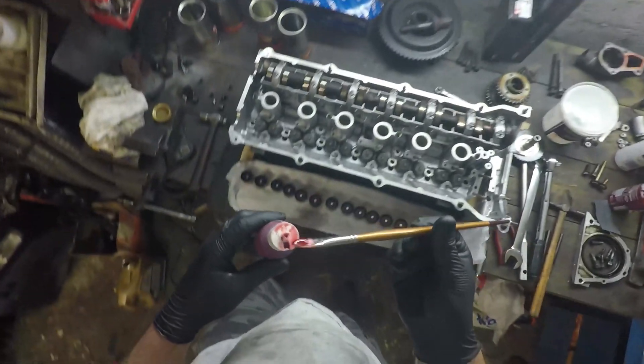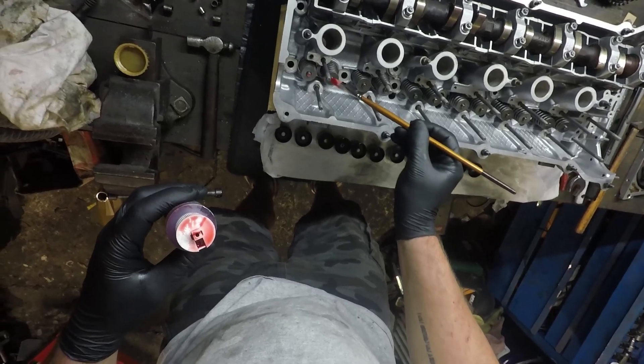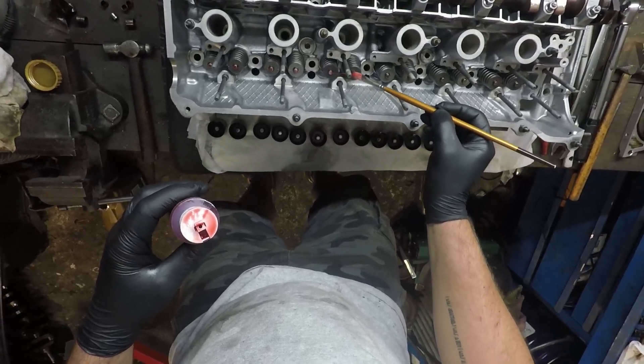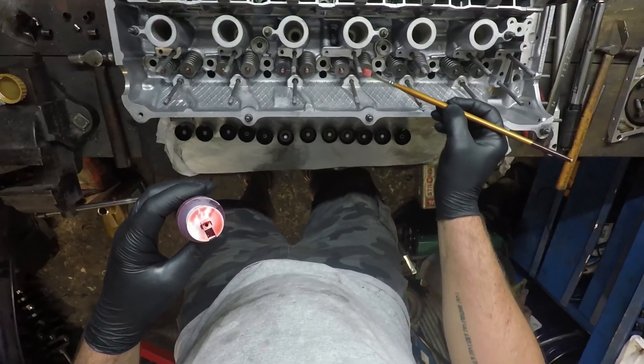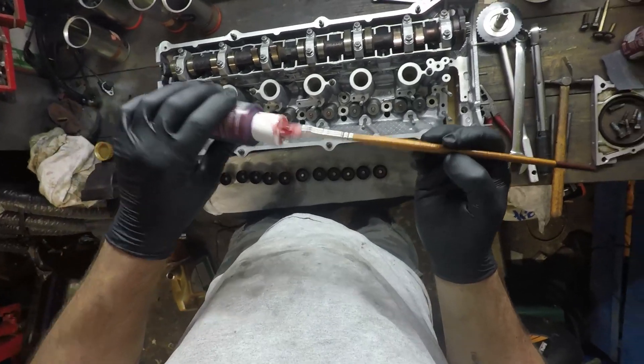I'm working in a filthy garage so I'm doing my absolute best to make sure everything's wiped down — no grit, no dirt on the outside of the lifters, especially where they run in and out of the cam tray, on the head of the lifter, and on the base of the lifter piston itself. Then we'll grab the tray. First I'm getting the assembly lube out and dotting a little bit on top of all the valves, since the lifter sits against that — I want a barrier layer before starting the engine to avoid any nasty grinding.